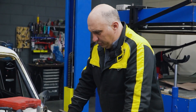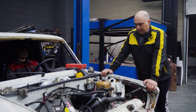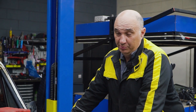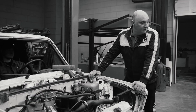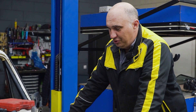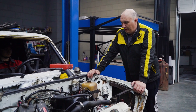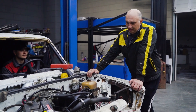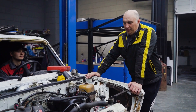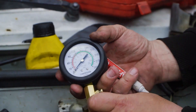We've got the motor assembled, everything is looking good. And now, just like I promised, we'll be conducting a compression test. Obviously, we've got a lot of oil inside the cylinders, which will probably increase the compression, though some of it might come out if we turn the engine with no plugs. Let's spray some oil.